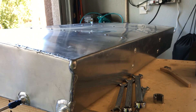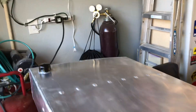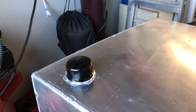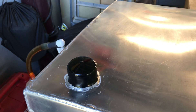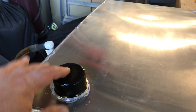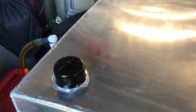The biggest problem I had was finding a way to cap off the filler neck. You can see over here that I've got this rubber cap on here now. The reason I need to do that is because I'm going to pressurize the tank and leak check it. The fuel caps are vented so I didn't have a way to plug those vents, so I did some searching on Amazon and got these two-inch diameter rubber caps — should be pretty easy to find.